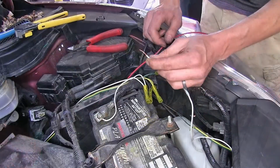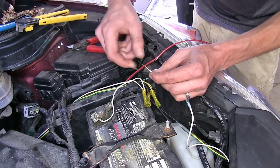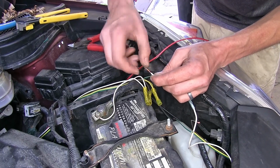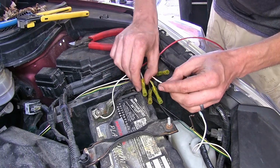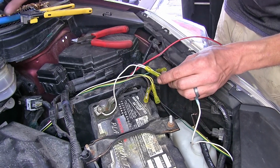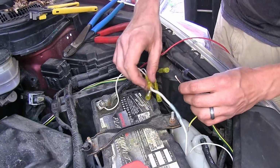Now the other end of our wire, which goes to the front of our vehicle on the 6-pole round connector that we have previously installed as part of our tow vehicle lighting wiring. We'll just twist the wire nice and tight, fold it back in half so it gets thicker, and we'll match the colors up, insert them in the appropriate butt connectors, and crimp them on down. And the white wires are ground.